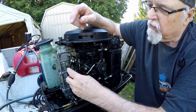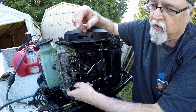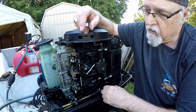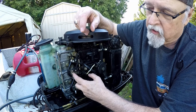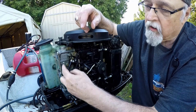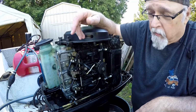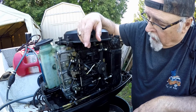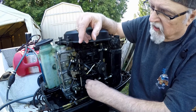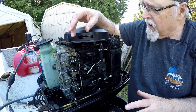the idea of it, you don't want the throttle shutters acting like a stop. You want the linkage setting to be the stop, not the throttle shutters, okay? Otherwise you'll mess them up. Okay, so that's all set. You tighten it down. Your link and sync is complete now.